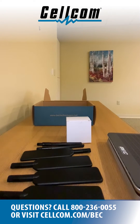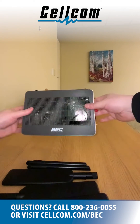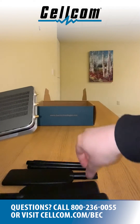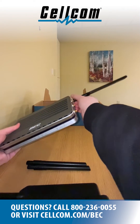In order for the BEC 6600 to service your home with residential internet, you first need to complete the following steps. Attach the 4G LTE antennas and the Wi-Fi antennas to both sides of the device. Make sure to remove any plastic dust covers from the antenna connectors before attaching them.